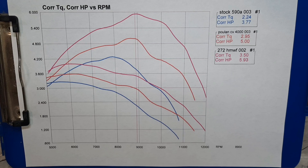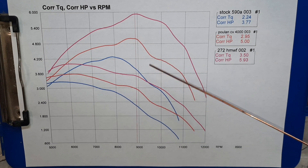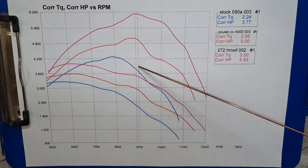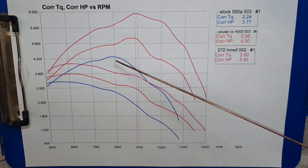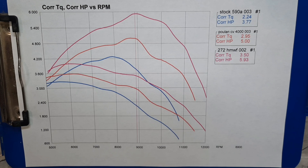Here's the results for the Counter Vibe 4000 and the 272/61 build. The 272 is up top — 5.93 horsepower at 8,900 RPM. The Counter Vibe 4000 is right at 5 horse at 8,000, and at that same 8,900. For comparison I threw on an Echo 590 Timberwolf — in the box it's 3.77 at 8,900, peak power back closer to 8,000 at just over 4.2, so about 4.3 horse for the 590. The Counter Vibe had a muffler mod, base gasket delete, and a little bit of port cleanup. The gentleman asked for a dyno run so he sent it in — I know there's a few people that like those Counter Vibes, leave a comment and let me know what you guys think about the older stuff.